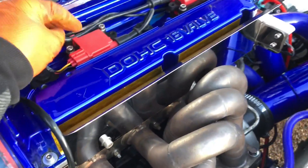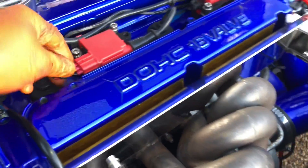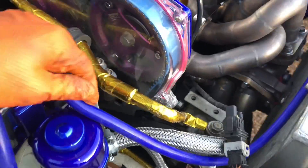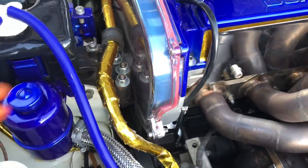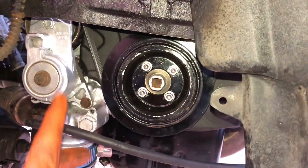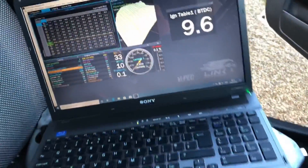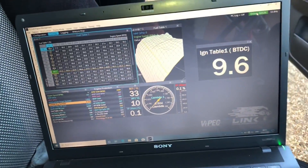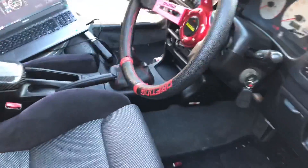There was no spark signal to the ECU, so I checked all the coils. You can see these plug connectors are in poor condition — not proper connectors. Checked everything over and it turned out to be a crank sensor issue. Changed the crank sensor, had to pull all the belts and covers off to do that, but it's done now. Plugged the laptop in to check everything over — all readings are perfect, no fault codes, engine has been turned over. Let's get this thing started.